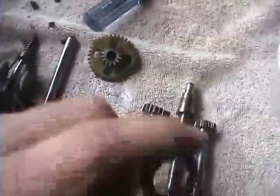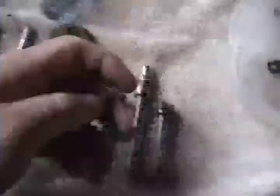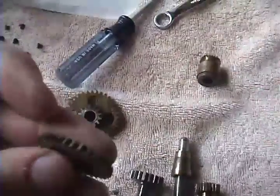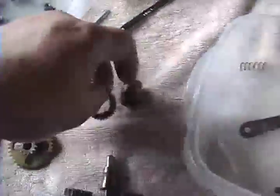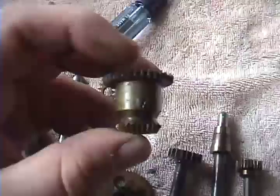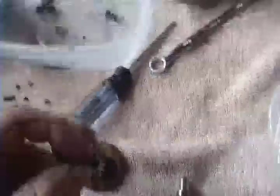This piece here is what I'm going to be replacing. The fiber gear that I'm holding on top is the wearable item, available at Shenandoah Restoration for about $49.95, and the replacement is made of nylon specifically for restoration projects. Be sure to save the brass gear that it mounts onto — you'll need that when you reassemble the unit. As you can see, the teeth are badly worn and the pin slot is actually damaged. I'll put the address in the video description.